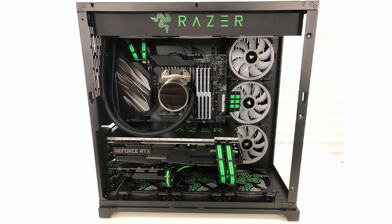I used all Corsair LL120 fans — nine fans in the case. The bottom ones were set as intakes supplying cooler air to the graphics card. The fans at the top were exhaust on the radiator. The slightly strange choice was putting the three fans on the back of the case as exhaust. The reason was that the LL120 fans look great the right way round but when reversed as intakes they don't look very good. So I had made that choice — aesthetics over performance.